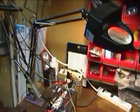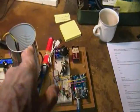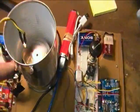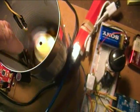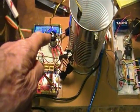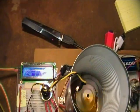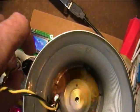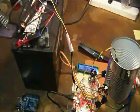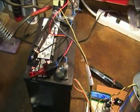In closing, here's my whole setup — of course with the scope up there. It consists of the distributor simulator, the Arduino driving the LCD, listening to the Hall effect sensor down behind the brass bar, looking at the strobe when it's dark, adjusting the pulse width of the coil charge time, and reading out RPM change and coil charge time. And then a simple switch, and an Audi coil pack — a 4-wire coil pack — making sparks.